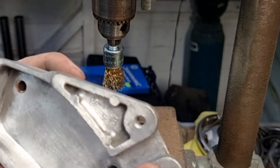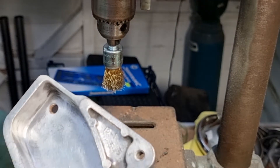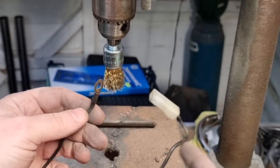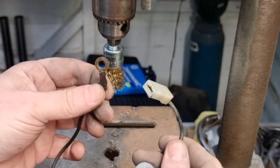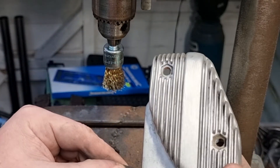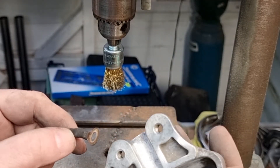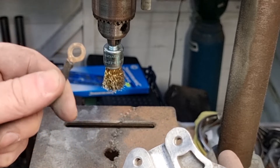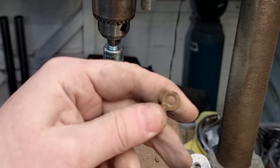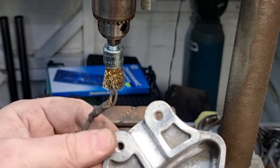We'll get a much better earth. Because your rectifier uses this cable — one of these, it was on one of these. And if it hasn't got a good earth the voltage can spike and your regulator doesn't deal with it. So this may have been the problem — the cause of the failure in the first place.